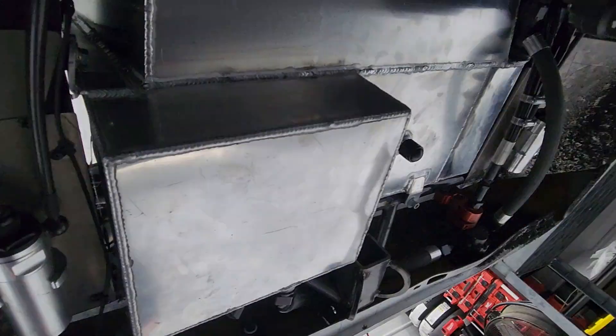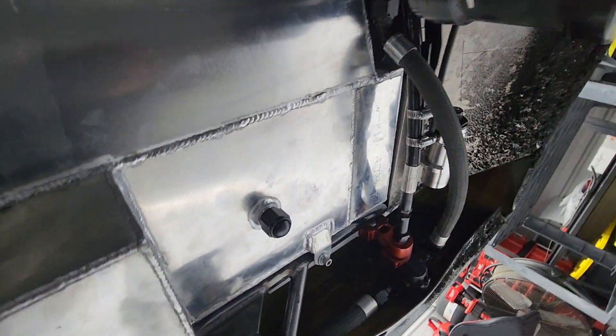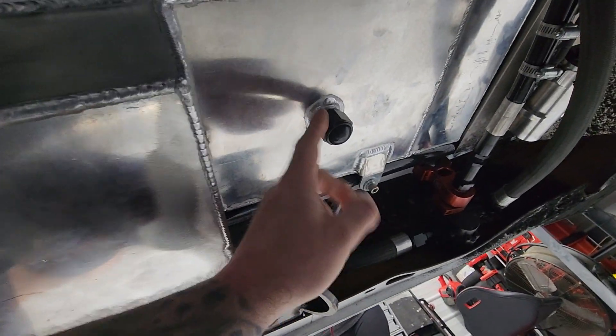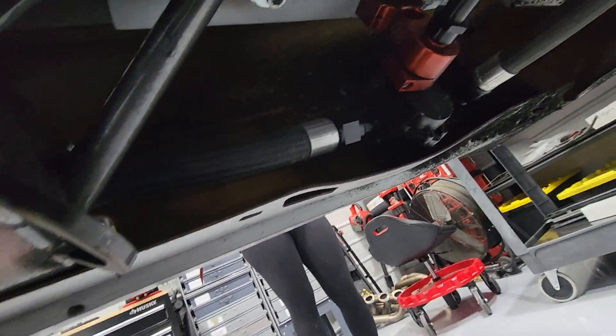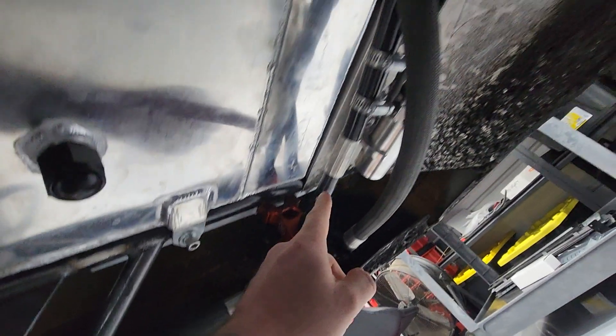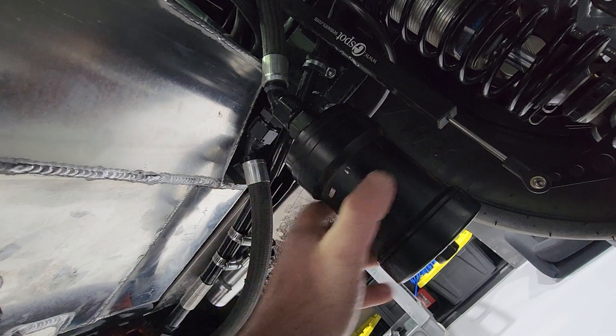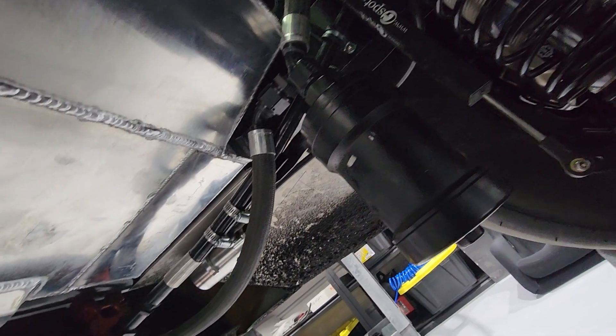Here's the cell — there are two different heights. This is the methanol tank and this is the gasoline tank. You can see how it comes further forward for all the capacity. This is just a drain, so if I want to drain this thing I just pull that off. We've got the methanol feed line coming here, over to the mechanical cable-driven pump, and this is the cable that goes forward. The hose comes out of here and goes to a System One filter, then goes up and feeds underneath the hood.